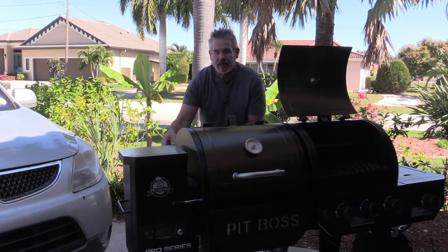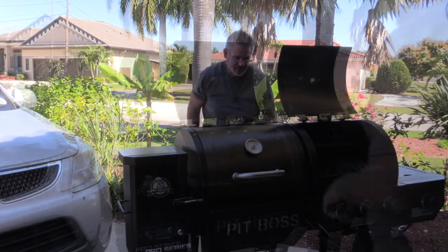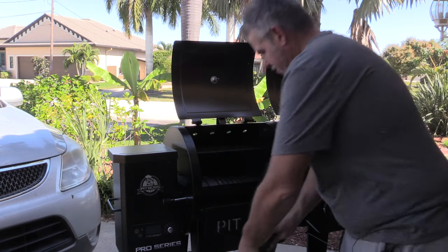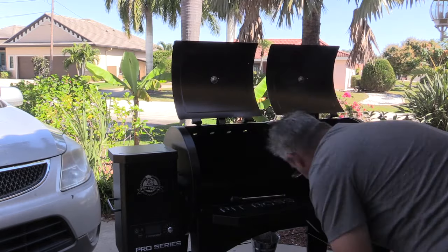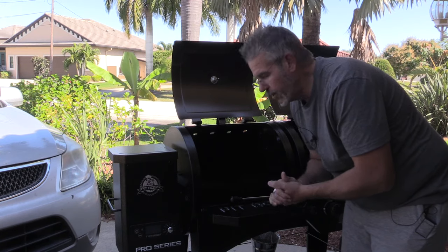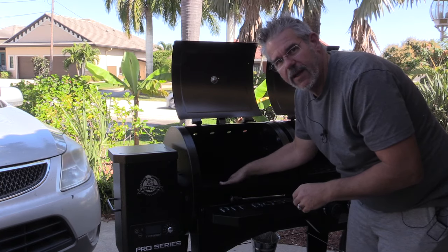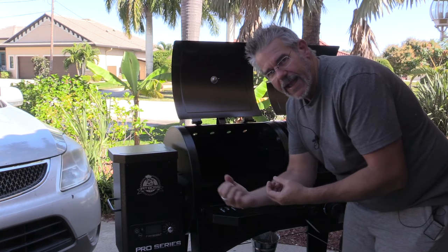I'm going to go ahead and plug in the unit. It's now just a matter of plugging the electric side in of the feed hopper, and we'll go ahead and turn on the unit. I'll show you what it looks like. Through heat transfer, this side's a little bit warm from that being on, but I'm going to go ahead and take out these grates so that I can see inside of here when I first start to do this. I've taken all of the grates out, mainly so I can see the fire pot in here. When you first start this up, we're going to power it up, put it on smoke setting, and validate that we can feel air and heat coming out of it — that tells us the heating element is working and the fan is blowing.